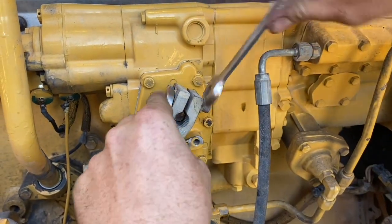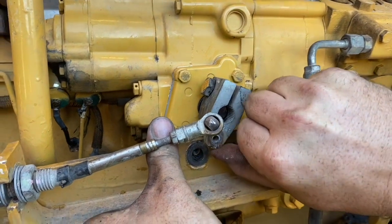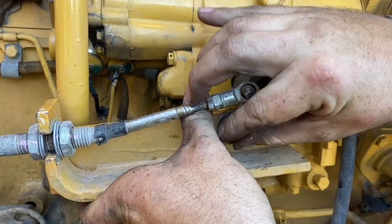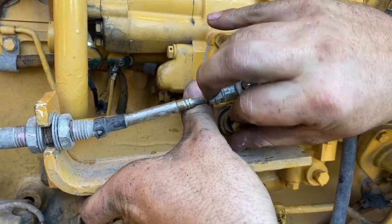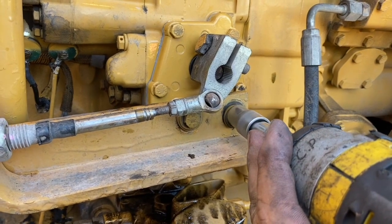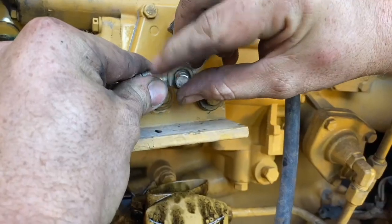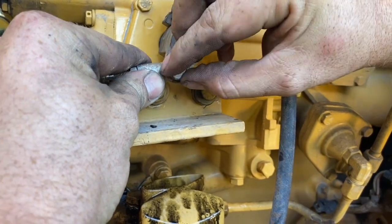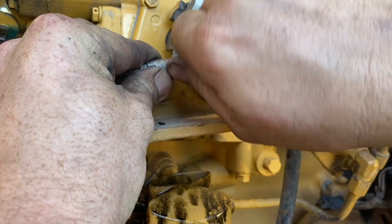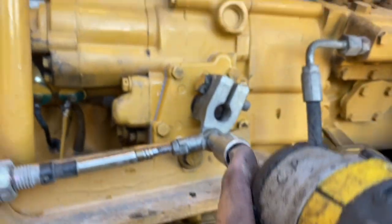If when you pull all this apart you find that your shaft has a bad groove in it, you can try positioning your seal differently in the plate and not drive it all the way to the bottom like I did — that'll seal on a different part of the shaft and should stop the oil leak. And that's all there is to it, pretty easy job and cheap on parts. If you like videos like this, consider subscribing to my channel where you'll find more of the same.